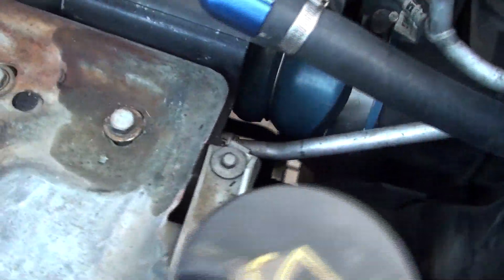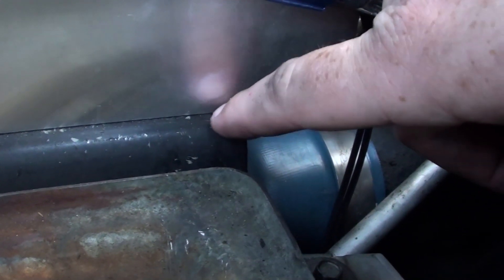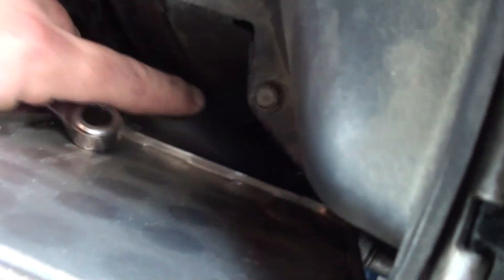So we're finally in. What I actually had to do was - the corner of this plate right here, there's a thread right at the back, and I had that all the way over here to move this thing forward, or to the rear of the truck. I had to move that back two slots. It actually fits pretty good, even with this line. I would still definitely recommend, if you're running into the issue that I have where they're rubbing, put that piece of hose around it. But it's really not pushing on it too bad.